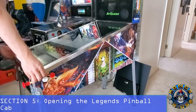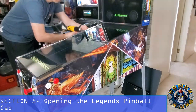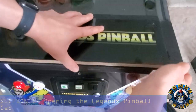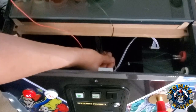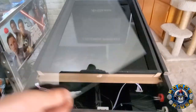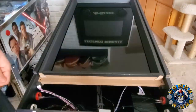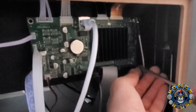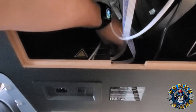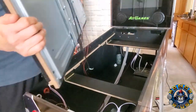To get inside the main cab, start by removing the five screws on each side of the trim and then the front three screws on the lockdown bar. Then lift the apron section with the D-pad and carefully unplug the five-pin connector cable and audio wire connection for the exciters. Carefully slide out the heavy glass frame and place it to the side, then unscrew the four bolts on each corner of the playfield monitor. Lastly, unplug the 30-pin connection from the monitor to the PCB behind the cab and the two-pin wires going into the power supply, and you should now be able to lift the entire monitor out.